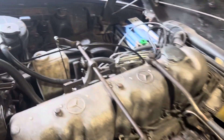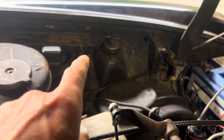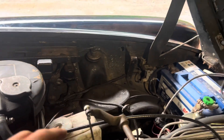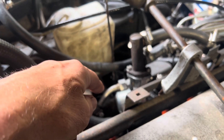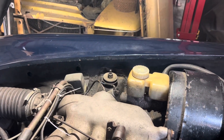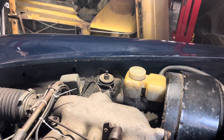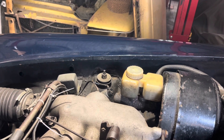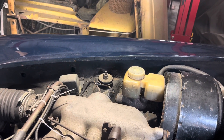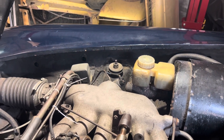At some stage after 1965, that round timed relay was no longer used. The injector pump enrichment solenoid would be activated every time you turn the key to start the car, and the cold start valve would be active for a maximum of 12 seconds when the car was at minus 20 degrees, all the way down to 0 seconds when the engine coolant temperature was at 35 degrees.